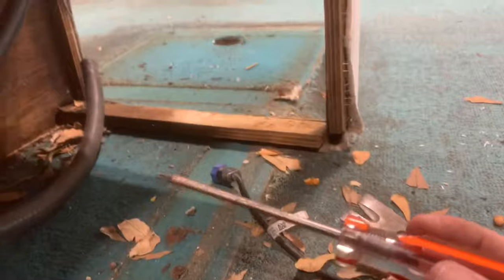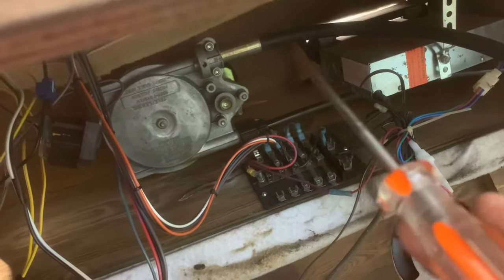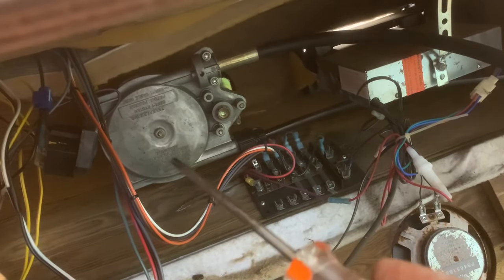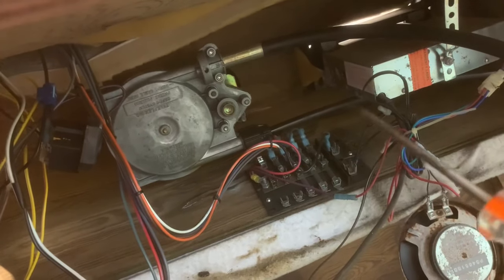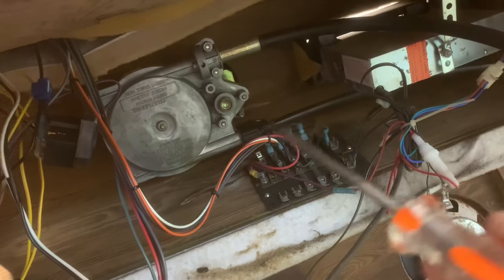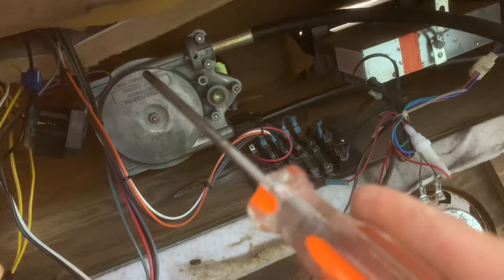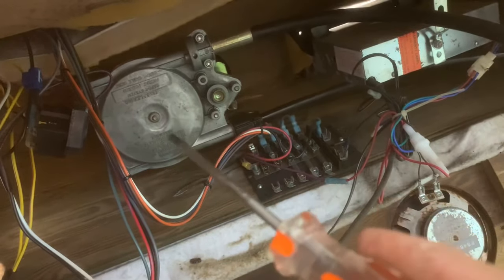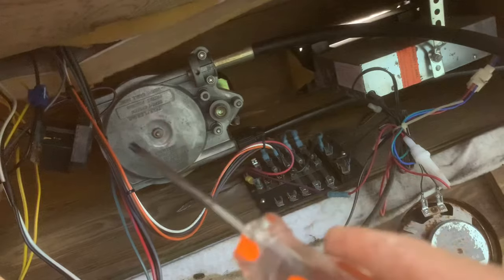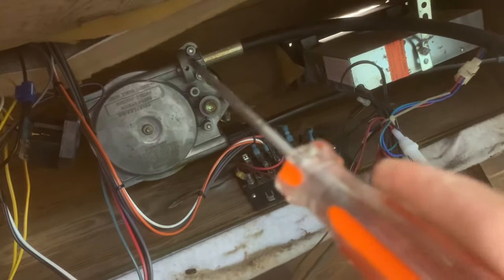I'll show you backing out this steering column. The cable is going to come out as you turn the steering wheel. The cable wraps around through the steering tube, and when you turn it the other direction you get the motion back and forth. The cable will feed out while the rest stays in. You would think you'd turn the steering wheel to the left to unwrap it, but on my other boat — Squirrel — I actually had to turn it to the right, and that's what unwraps the cable.